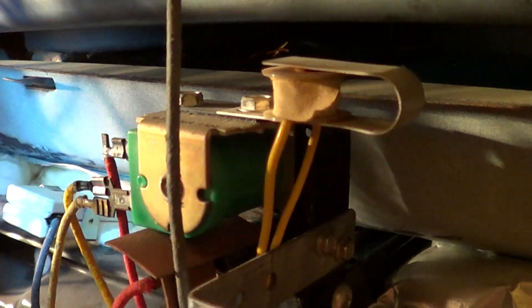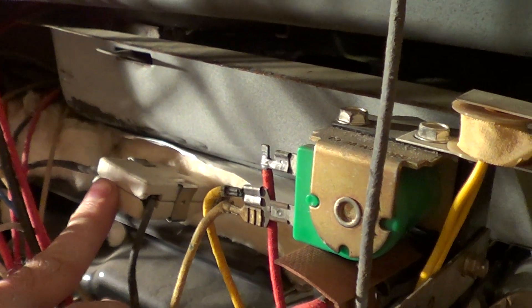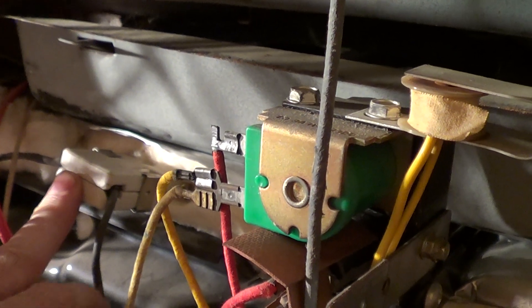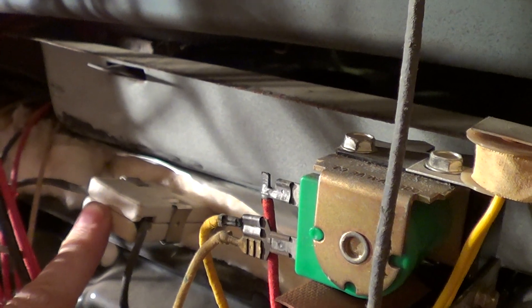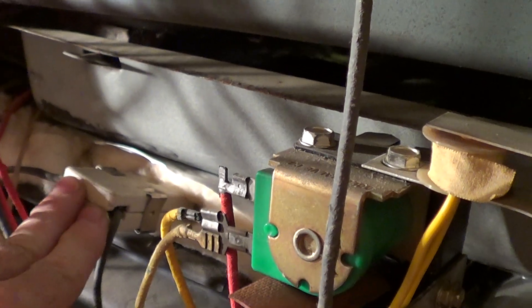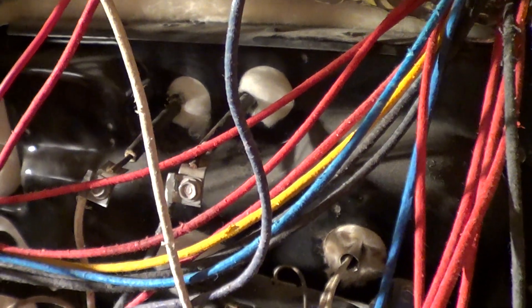There's another component in this self-cleaning oven called the Smoke Eliminator. There are two different models that General Electric made. This one has a resistance of about a third of an ohm. It's in series with the bake and broil coil, and it's basically like a catalytic converter — it burns off the crud in self-cleaning mode. It goes through the upper left burner, in series with the broil coil and the mullion coil. The mullion heats the front door, so this oven has a whole bunch of different things on it.